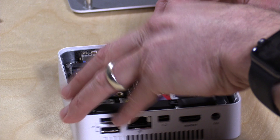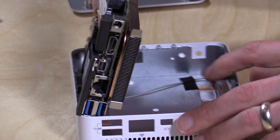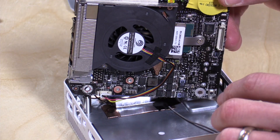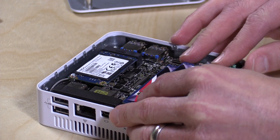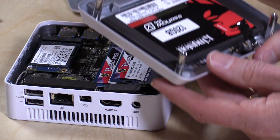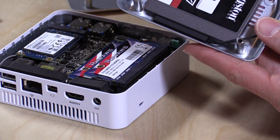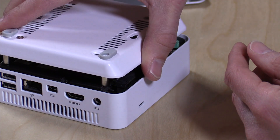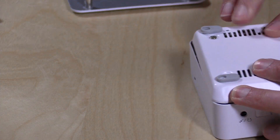You can also lift up the board to see what's underneath. I'm all grounded so don't worry. On the bottom we have the fan and heat sink for the Broadwell processor, but it is a very compact design overall. MSI also has another bottom panel that will accommodate a larger 2.5-inch notebook SSD, which adds a little bit of height to the overall package but does let you use a traditional solid state disk.